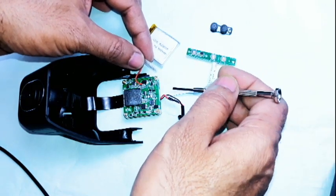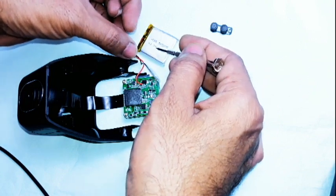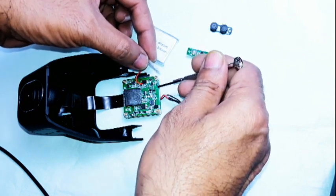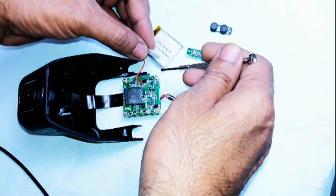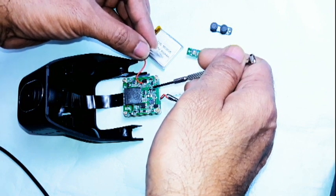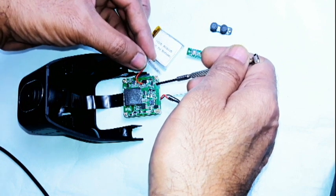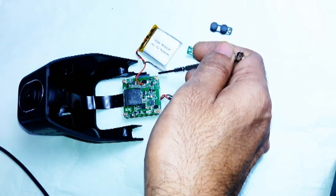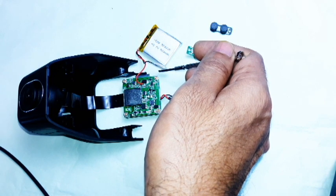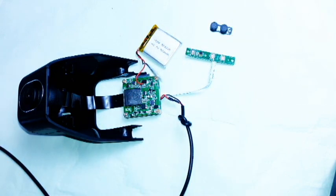So here is the close-up. Basically, the negative charge from the battery — the 500 mAh 3.7 volt battery — was connected where it says B-negative. After removing that, I was able to reset the car DVR and my Wi-Fi was able to connect to my phone. I'm going to share a short video to show the clarity of the Wi-Fi DVR. If you like the video, please give me a thumbs up and subscribe to my channel. Thank you so much — this is Tony signing off.